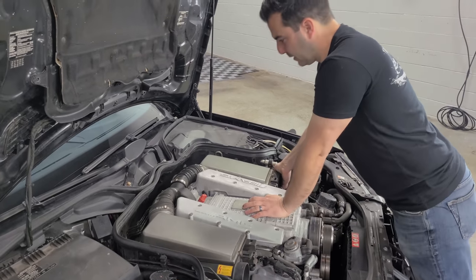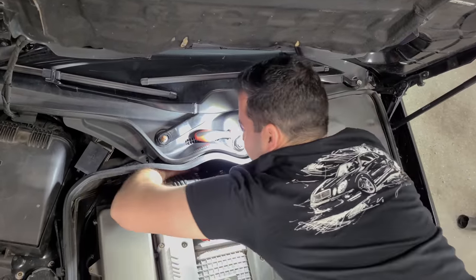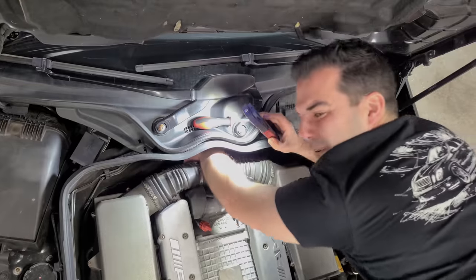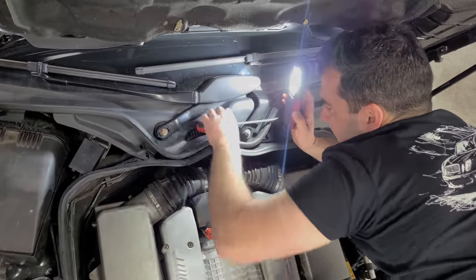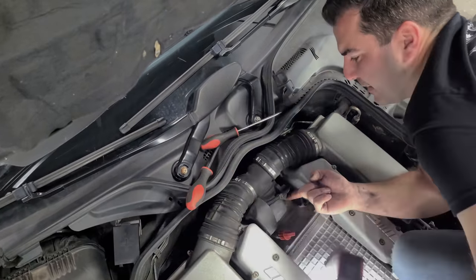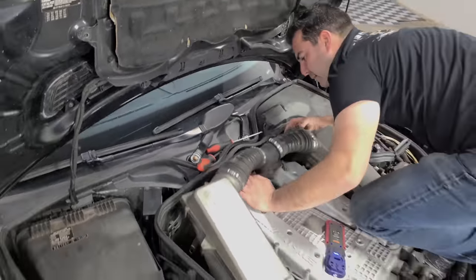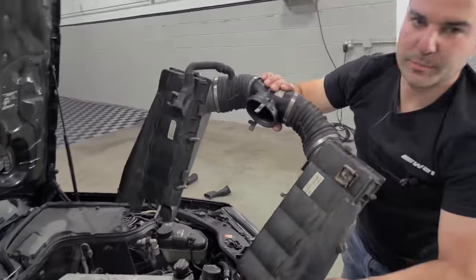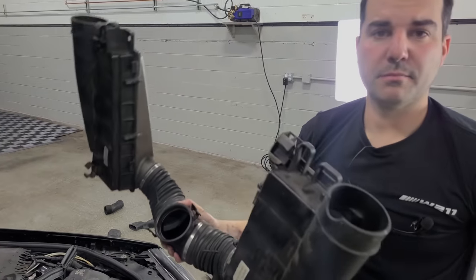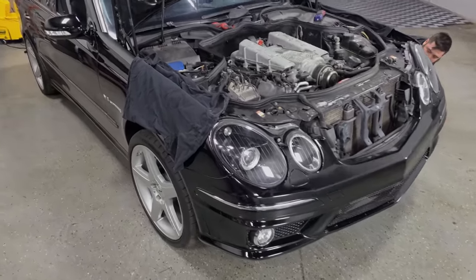Let's pop this up and take this clip off — that's the easy one. Most people just break off the bottom one; I've seen so many of these engines with no clip on the bottom. They are a total pain to get to, but don't break your car — just spend the extra few minutes, get a pick in there. Both clips intact. We're going to go ahead and remove this front bumper now because we need to remove it to install the secondary heat exchanger anyway.